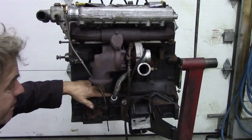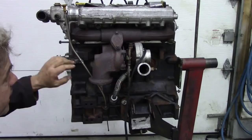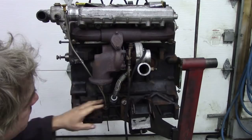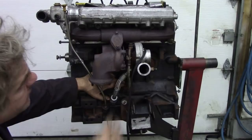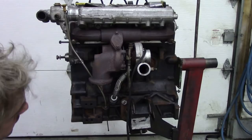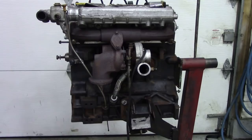So what you've got to try and find somehow is a little slim spanner to fit under there and take it off. Now, a good top tip of mine is to take the dipstick out first, because you've got to take it out anyway, and then you can get that off. Then you've got your oil feed pipe at the back, this one here, that comes off. You don't need to take it off there as yet. Well, you need to take it off there to get to the bolts in there, but that has to come up loose off here. Like I say, engine mount, manifolds, and then it's just 15mm sockets to take off the manifold. So that should be quite straightforward, and let's get that done before dinner, because I'm hungry.